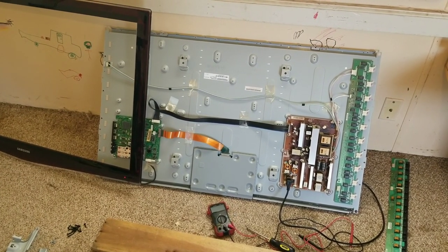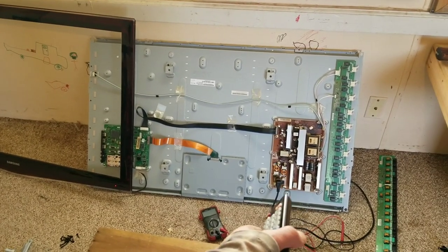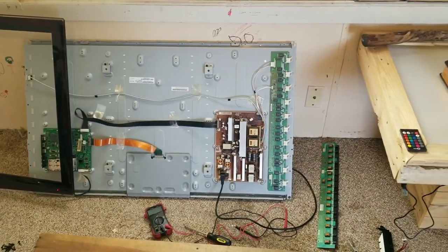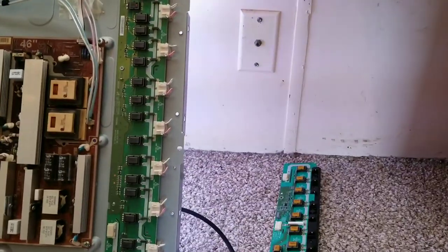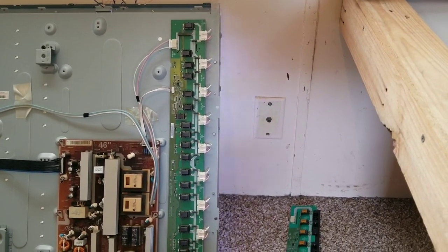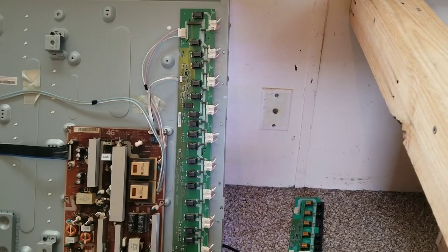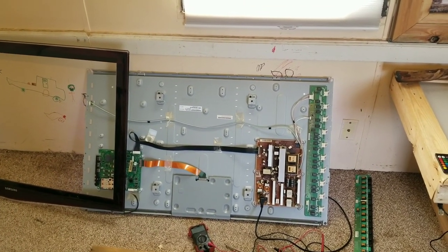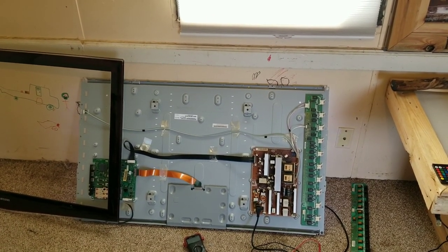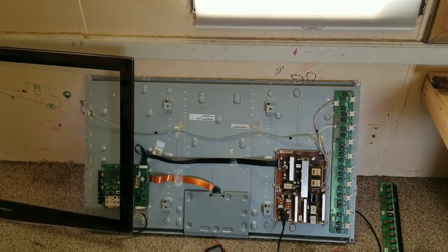Since the original donor TV had an LCD display problem rather than a backlight problem, what happens if I just swap the entire board? Whoa — check that out! It came on next to immediately! There's a little bit of flickering going on, but it actually kicked on way faster. I'm going to put this back together and see if I can get a full picture. All glory — that may be resolved. Who knows how long that board's gonna last, but man, that is just rather nifty.